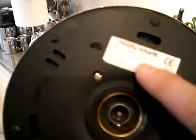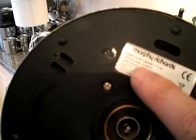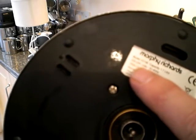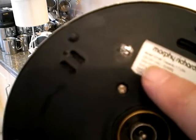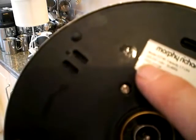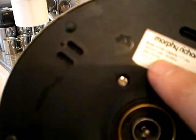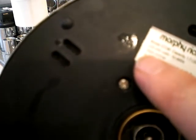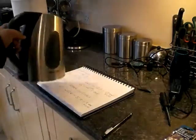Now it's got some gobbledygook on here that we wouldn't understand some of it. Anyway, I'll just tell you what it says: 220 to 240 volts for the United Kingdom, 50 to 60 hertz. But the one we're interested in here, it says 2500 to 3000 — big W at the end, capital W. Now that means watt, the watts. So it draws — I'm going to go for 3000, the maximum there — 3000 watts. That's what I'm interested in; I need that figure.